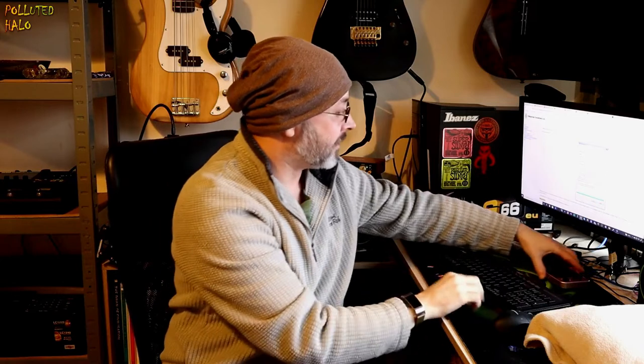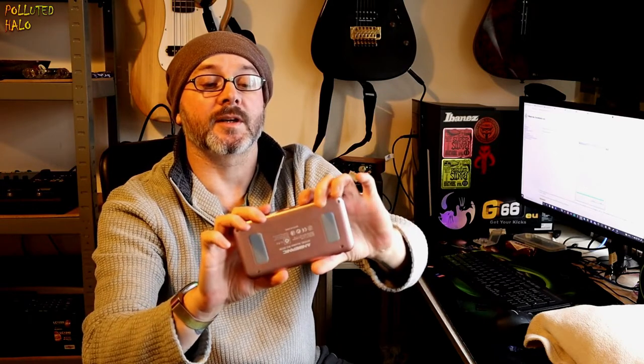I've got a 32 GB SD card here, like a micro SD in a little card holder. I've got some games on here for the RG350 — this is an RG350M, which has a metal case. Basically, I just want to upgrade the SD card. At present I've got 32 GB, which is fine, and you can format 32 GB cards relatively easily with Windows 10 because it's all built in. But anything beyond 32 GB, it won't handle.